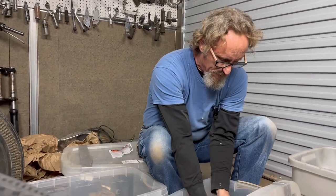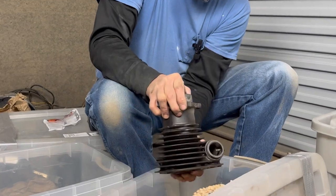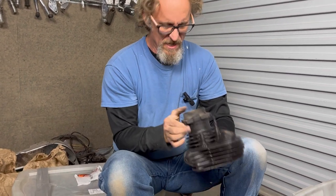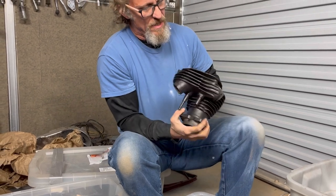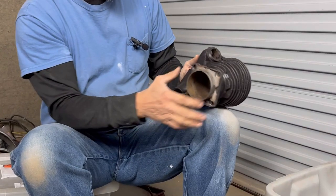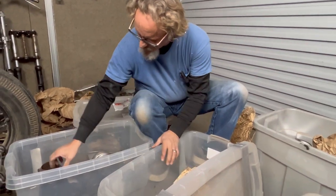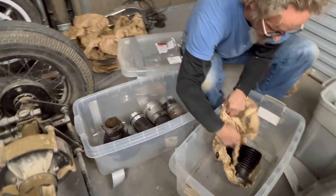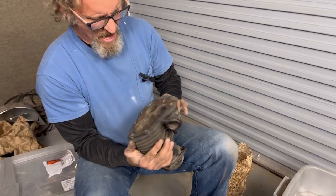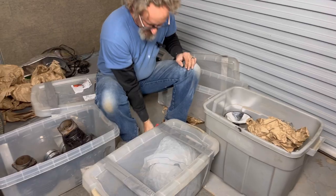There's what looks like a clutch spring for that clutch basket. Now here's what I've been looking for — a matching set of cylinders. I've got almost a whole motor out of this. They've got to be rebuilt — valves redone, cylinders honed — but there's enough meat there and no broken fins. The threads for the intake are good, and a lot of times you'll see cracks on the exhaust ports, but these look good. Nice set of jugs. Here's the other one — got a little ding but it's salvageable. No broken fins, needs valves but that's easy enough. A buildable set of jugs.